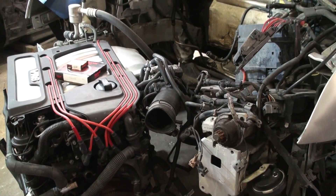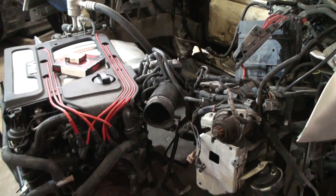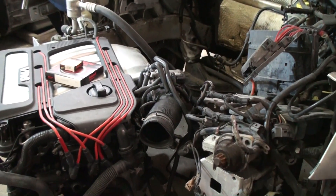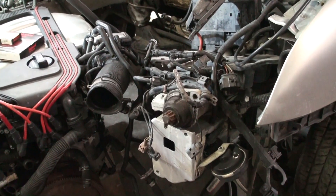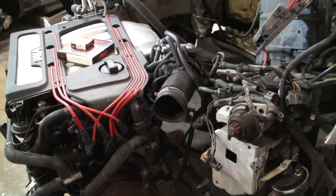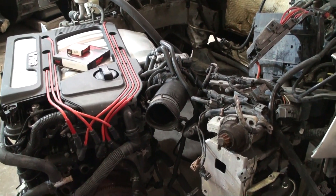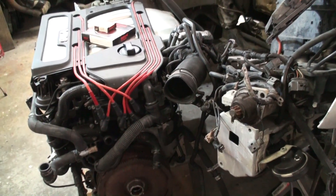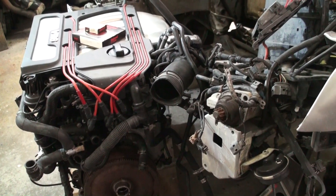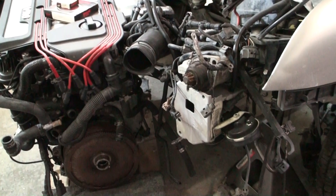I can't wait to try this thing out and get it on the road and see what it runs like. Now if you're switching from the 2.0 motor to the VR6, one thing you will have to switch out is the starter — it's not going to work. The 2.0 transmission will work, but one of the problems you're going to run into is you can snap your input shaft on the transmission, so you definitely want to go with a VR6-style transmission.